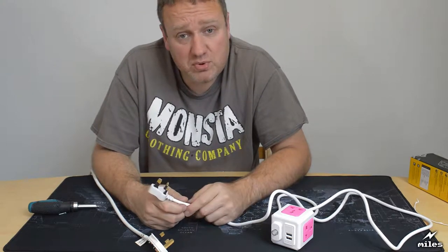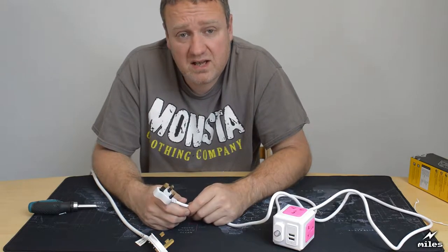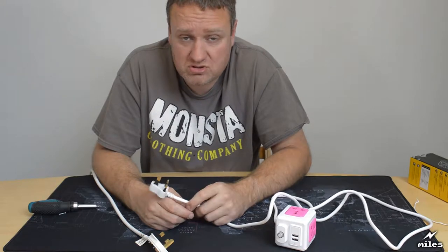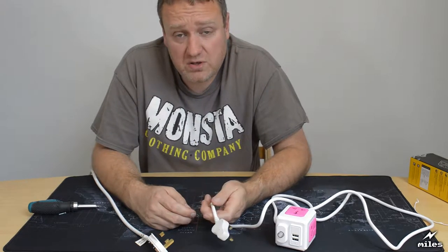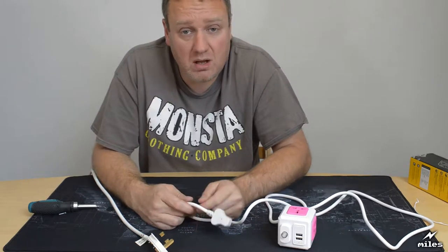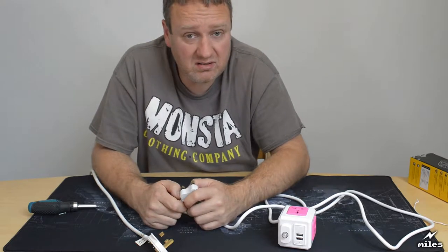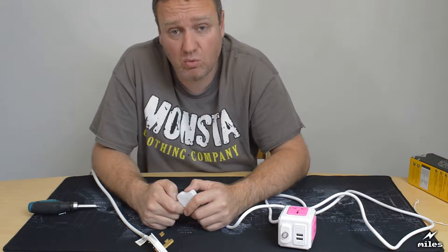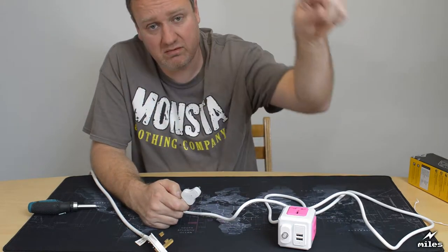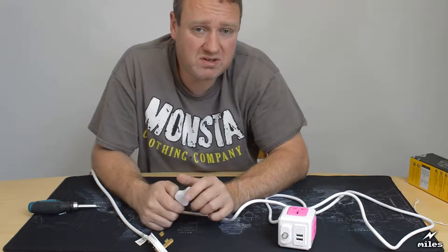We still have a fuse board, we generally call them consumer units these days, and inside there is a very large fuse, much bigger than the ones you get in countries like the US, and that very large fuse protects a whole ring. And a ring basically consists of a big loop of sockets. There might be 10 sockets, there might be more, I've seen them up to 20 sockets on one ring. So it goes off to one, it loops them all together and comes back to the fuse board. So you do have that fuse, that protection, but it's very, very big.